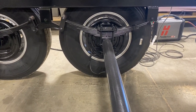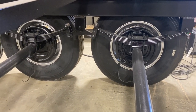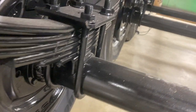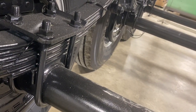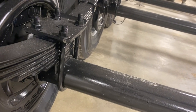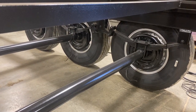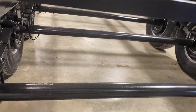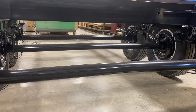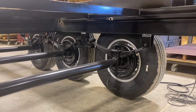This is one of our camp frames — you can see the axle sits below the leaf spring pack, which gives quite a bit of clearance. That's what we're trying to accomplish with this trailer. There's a perch that sits right on top of the axle, welded to the axle tube. A lot of people flipping axles think they can just roll the axle and put it on the bottom of the leaf springs, but the problem is these axles have a bow to them. Doing it that way reverses the bow and you'll wear tires out extremely fast.